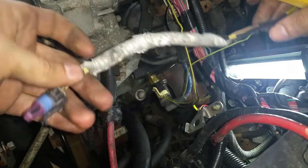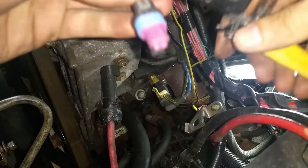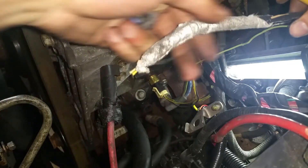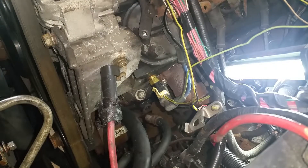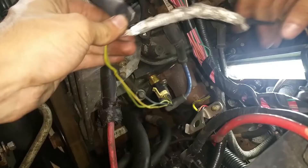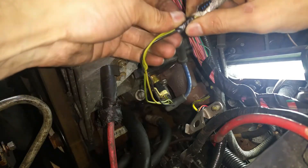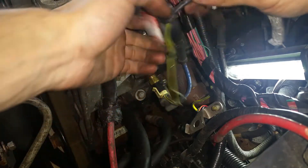I'm going to take this factory plug and snip this one off because I want to keep this piece here — it's going to be down by the exhaust, so I want to keep this little tube with the wrap around it. I'll pull the wire out and try to run the new wiring through it. There's a little trick for running wire through existing loom: keep the existing wire in there and use some tape, because there are three wires I'm trying to pull through. Throw some tape around it so it doesn't slide off.